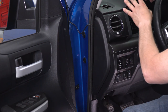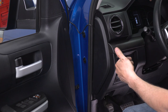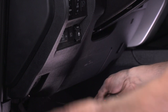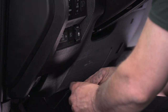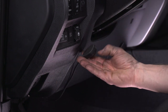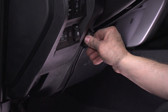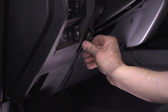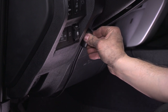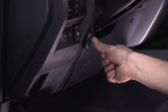If you want to put a hole in your firewall with a hole saw and come through with a grommet, that's even a better way to do it. But on our vehicle we're not going to cut that up. Now that we've fished our wire through, I have my switch to turn the rear fog lights on and off. Just pull the backing off and mount the switch right here. If you have any alcohol rub to clean any grease, wax, or anything off of it, it's not a bad idea. Push it to make sure it's on — it's pretty much just a simple on and off switch.